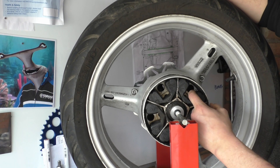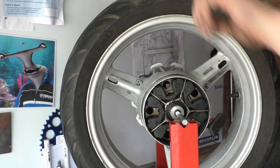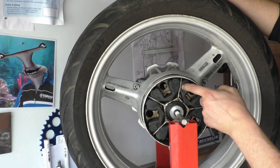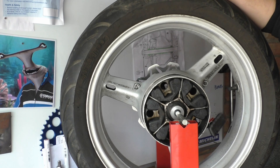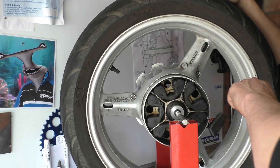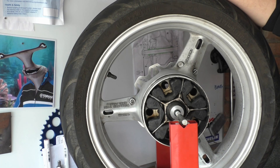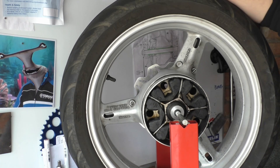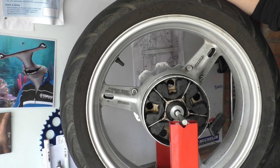What these are for is to soften the blow, to dampen — that's what these are, they're dampeners. They soften the blow so the torque can ramp up more gradually instead of a sudden impact. If you had a sudden impact, eventually you'd wreck these dogs and these webs in here. Cush drives are there to stop this shock loading, because that shock loading will make your wheel resist wanting to turn and travel backwards through your sprocket, through your chain, and all the way up through your transmission to your clutch. So your clutch is allowed to slip and these are allowed to crush. Why is it called a cush drive? Because it's a cushion drive — it takes out all the severity and stops you wrecking your chain, your sprockets, and your gearbox.